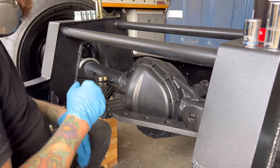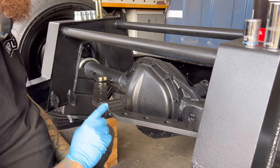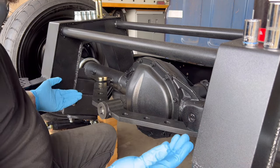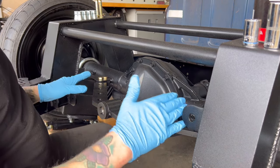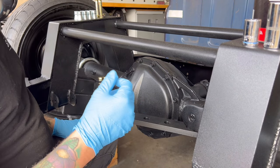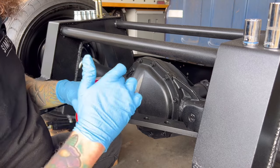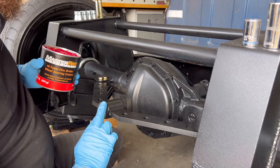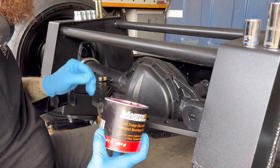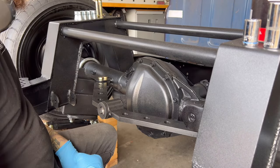I'm getting ready to install this middle section back together. Something I talked to Alex about is whether this needs to be greased, and he said he greases everything — even the bolts that go in, just a little bit — so there's no squeaking. Remember, these parts are going to be going up and down and moving around all the time. I'm going to use some high-temp grease — the same I use for my disc brakes — put a little on the bolts and all over this section. It's better to have all this greased up so it doesn't squeak and everything moves really nicely.